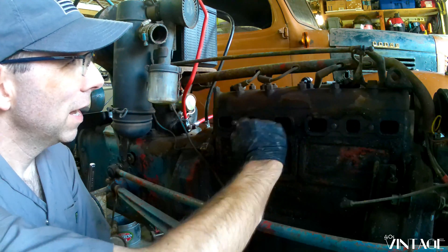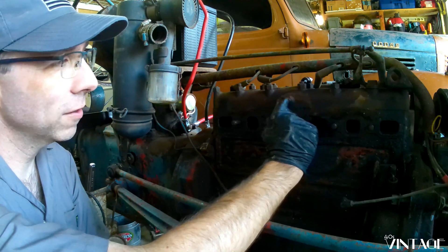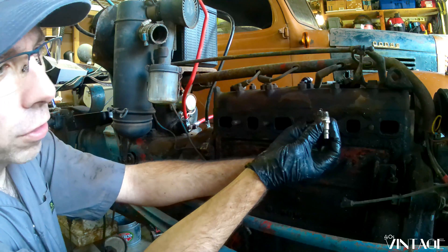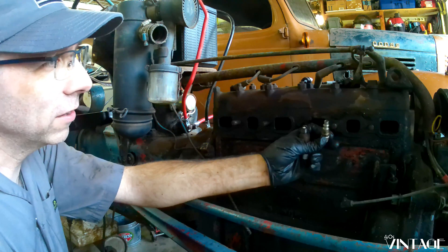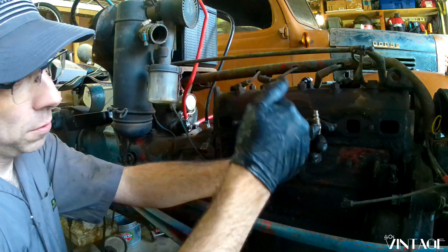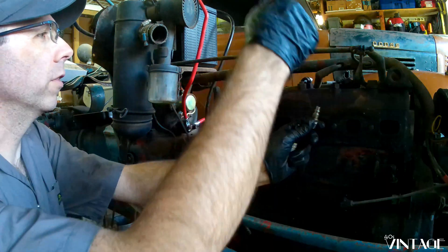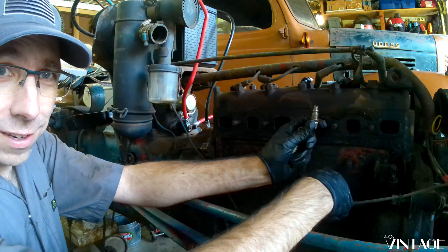Now, I could show you what this tool looks like, but I don't have one. So I'm going to do a poor man's method. What I discovered when I was poking around is the threads on my spark plug holes happen to be identical to the threads on a quarter NPT quick disconnect for my compressor. And my air compressor has an air gauge on it. So the theory is if I bring my cylinder up to top dead center on the compression stroke, screw this in, and pump it full of air with my compressor, I can actually watch the gauge on my air compressor. And I can also listen at the valves or at the breather tube or the oil fill to see if I'm hearing air come past. That's what we're going to do. Wish me luck.